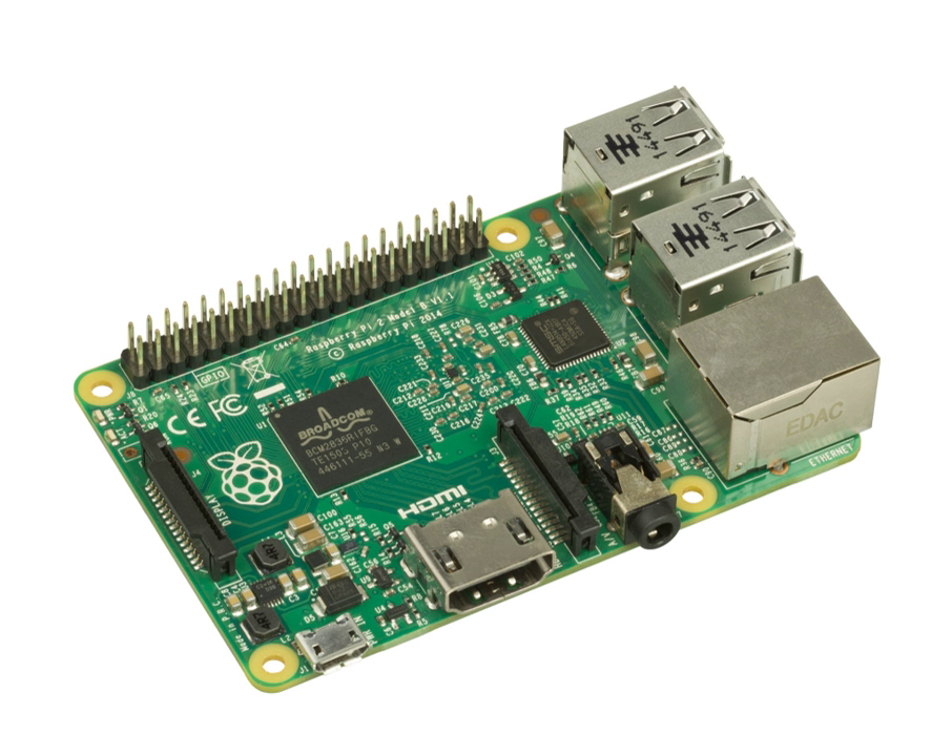In the Intel PC world, the intelligence and interface control circuitry is placed on a plug-in board that is then inserted into a passive backplane. The end result is similar to having a system built with a motherboard, except that the backplane determines the slot configuration. Backplanes are available with a mix of slots, usually totalling 20 or fewer, meaning it will fit in a 19-inch rack-mount enclosure. Some single-board computers have connectors which allow a stack of circuit boards, each containing expansion hardware, to be assembled without a traditional backplane.